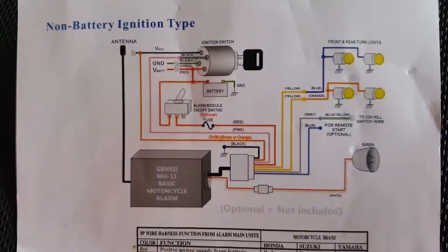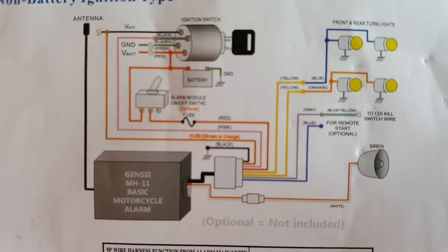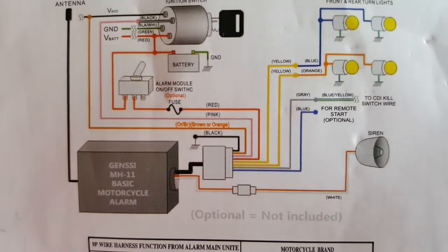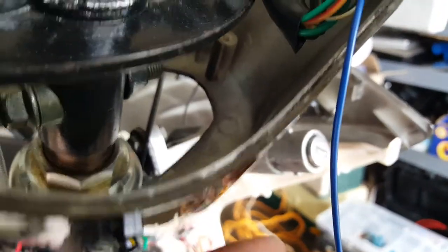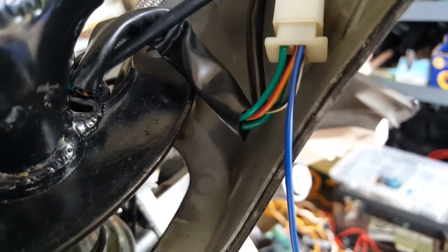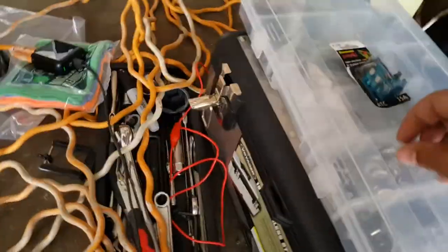We're gonna turn it off — we don't want the running lights too much because we have the key on. Let me take the key completely out. We're gonna hit the switch again — that's the lock. Unlock it makes a double beep. Normally when you unlock it, you push this once, then push this twice and hold on to it, and it should start the bike — if the blue wire is supposed to be for the auto-start. That blue wire is still there coming from the alarm. We tap it to the black and white. Didn't the diagram say something about the pink wire going to black and white? We're on our third fuse now — the original fuse popped right away. They were 15-amp fuses.